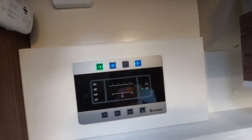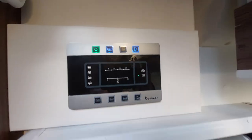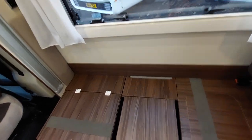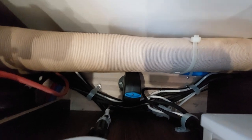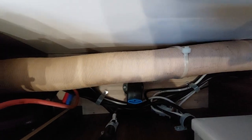Once you've filled up your fresh water and you put your pump on it will illuminate blue. You also want to make sure that your frost protection valve is in the right position — that can be found underneath this little section here. Your frost protection valve is the blue valve just down at the bottom. In the position it is now, with the diamond pointing front to back, it will allow you to fill up the boiler.